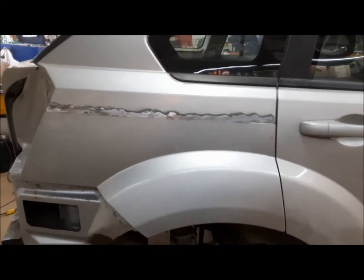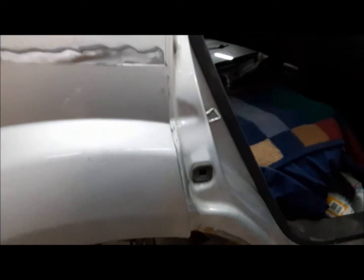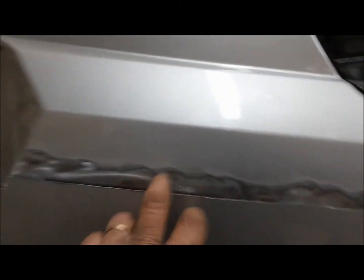While we're gaining on it, there's other stuff we have to do. You can see here how when it goes over, it really tightens up that door gap. Even though it's okay, we need the panel to move back a little bit because we need it to fold over the back properly. So that's why we're going to put a little nick in this here, and then this flange here we'll just bend it in ever so slightly as well as putting the flange on here. We want all surfaces of it to be on the same plane in the three dimensions of space that they were before. So we're going to go ahead now and flange this.